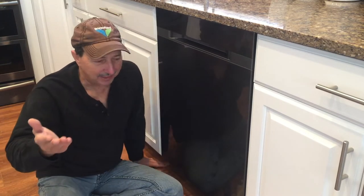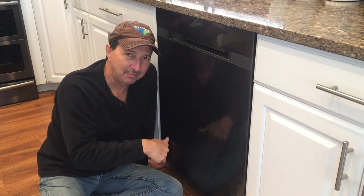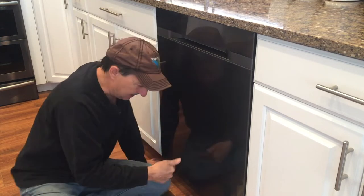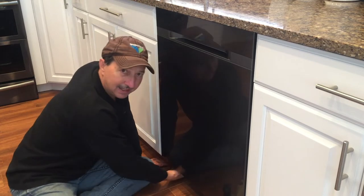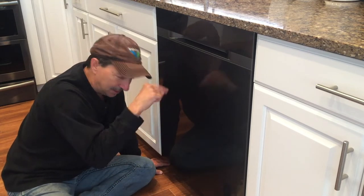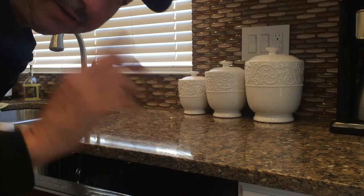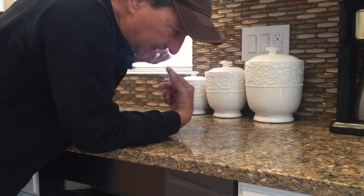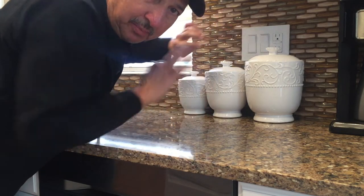This morning I got up to another big puddle right here — and there can't be, because the water line was shut off. So I'm going to start by taking that water line off. If water is coming out of that line, it means my valve isn't completely shutting off, and then maybe it's the valve on the front of this machine. My garbage disposal is on the same breaker, and so is my light, so I know the power is off.